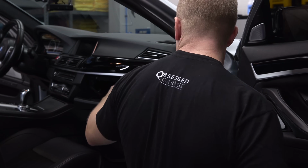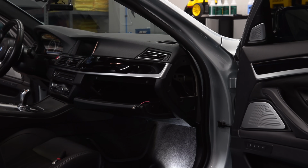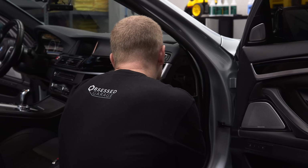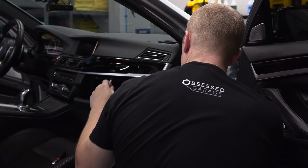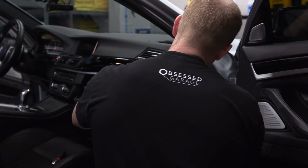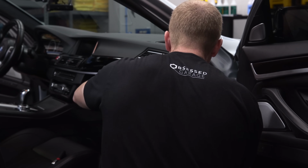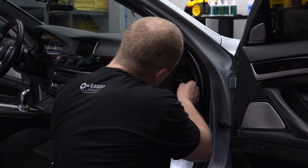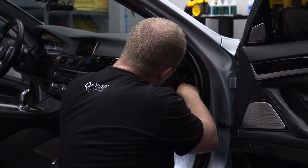I'm gonna need a little shorty screwdriver, I think. Since I have this little grounding shim in here, I don't know if that's gonna affect my ability for this thing to screw in. Yeah. I'm gonna get a better ground. Just do a self-tapper. I'll self-tap and screw right here to this metal piece. That's what I'm gonna do instead, right here. Do it on the inside.